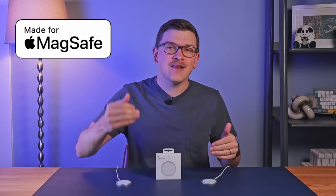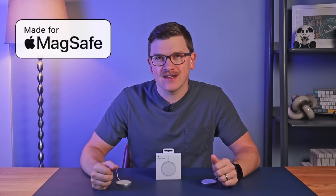So what does this all mean? Now any Qi2 charger can provide 15 watts of power to your iPhone without the need for the much more restrictive "made for MagSafe" label that Apple previously used to restrict access to their official charging spec and those higher speeds. At the same time, this new MagSafe puck can achieve even higher speeds with the latest iPhones, much like how some phones could charge faster than the original Qi standard with proprietary chargers. This is like deciding between good and better rather than the old standard where a 5-watt charger was just painfully slow.